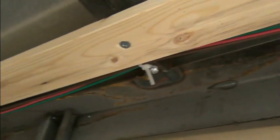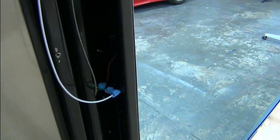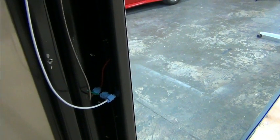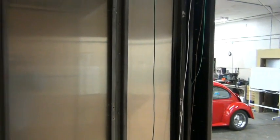And of course the wire's just all loose in here to rattle around and, you know, maybe get caught in the spring pulley or something. Just a quickie job. We'll fix all this up, stick it in some split loom, replace the cheapo connectors with something better, protect the wiring from any possible chafing and that sort of thing. So a lot of work to do in doing one of these conversions, but it's like anything else, you just do it one step at a time.